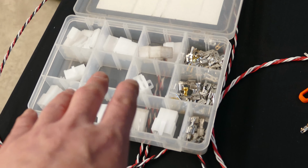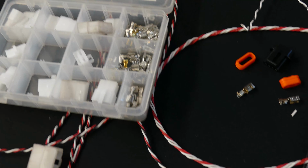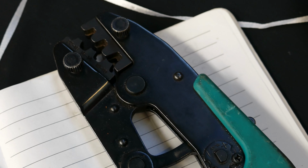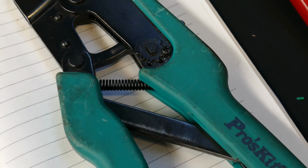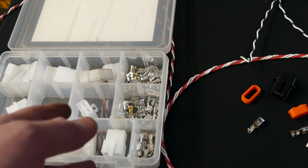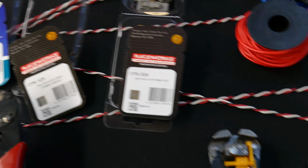If you're just going to use these kind of terminals, you could do it totally on the cheap and use those really cheap $20 electrical ones. If you wanted to do a more quality job, say a decent terminal, you're going to maybe use a ratcheting one that comes with different jaws, which is maybe going to be $50. So straight up, to run with these plugs, they're a cheaper plug, but also the tools to use them are significantly cheaper. So if these are, say, $150, you can get away with a $20 pair of crimpers to do those.